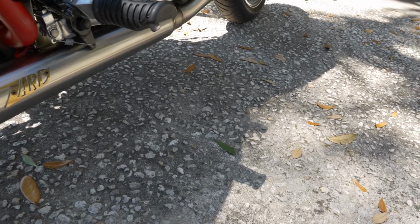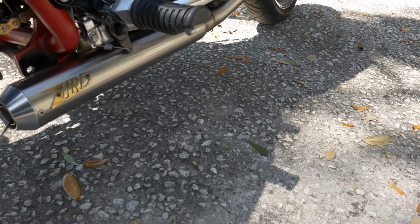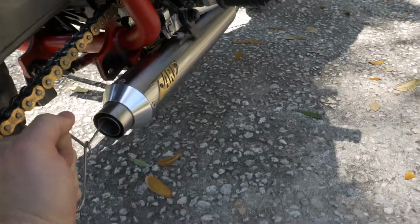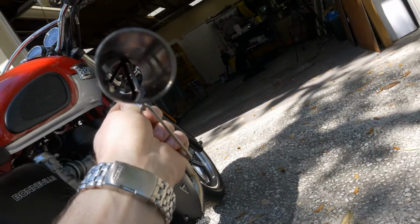So I had to take about, I think it was 4mm, a socket head screw out of this cone. This cone is machined. So what I'm going to do here is catch that cylindrical rod like so, and you just pull straight back. Ooh, yep, gruesome, I know. Hard to look at, but there she is. That's the baffle. It's just an open end with that pin on the inside I was talking about that we hooked it by. Nothing to speak of except it gets a little wider down here to seal on the flanged end.